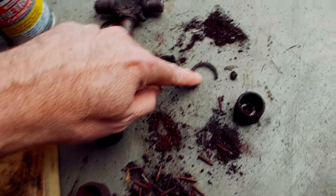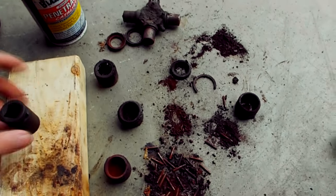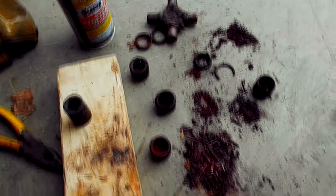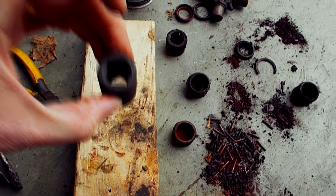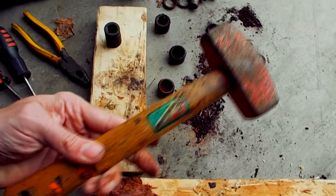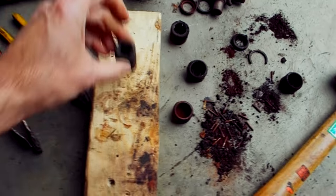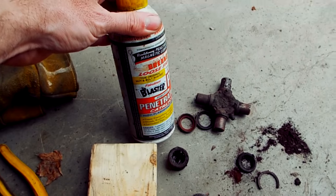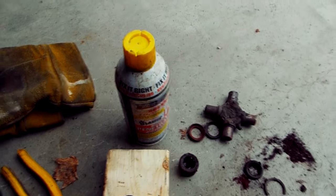Now that I've replaced it and used all four of the clips on the end caps. There are a lot of videos on YouTube about changing this out, which is why I didn't record the actual method — using this impact socket with the end of the drive shaft sitting on here, the other end sitting on a piece of cardboard, then I used good old mini Thor here, the mini Thor hammer, to pound those caps down through the drive shaft after applying some PB Blaster to loosen it up. This stuff really works well at loosening rusty parts.